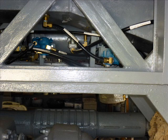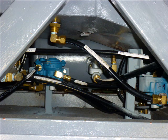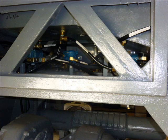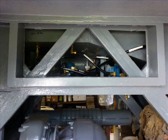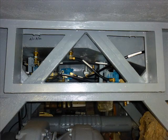As you can see in these photos, it is very very tight to get in the areas where I had to work and do all the plumbing necessary to install my new air brake system. All new airlines were labeled to track where they run per my schematic. Here are a couple of close-up photos of the new tunnel area, which will be totally enclosed to protect the new air system completely, including the air tanks.